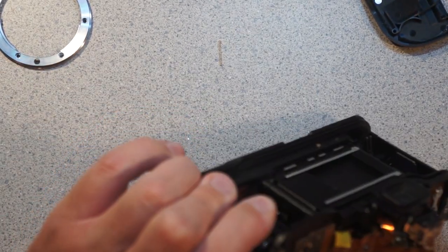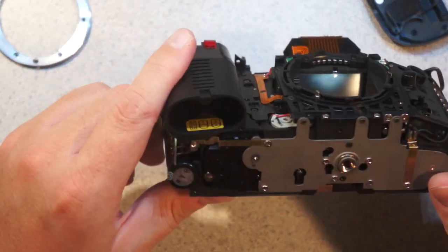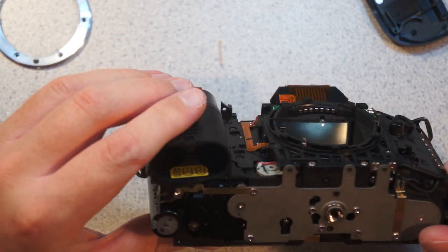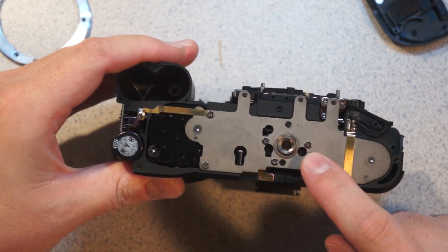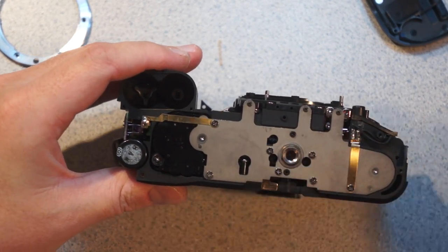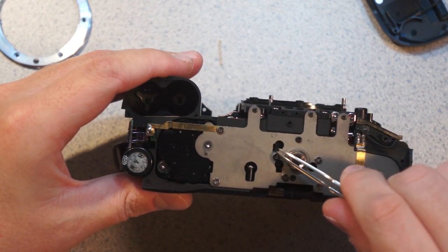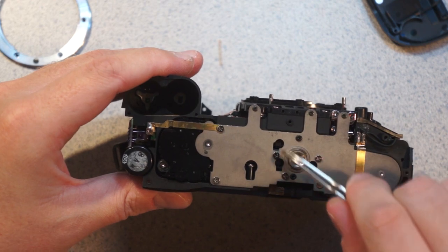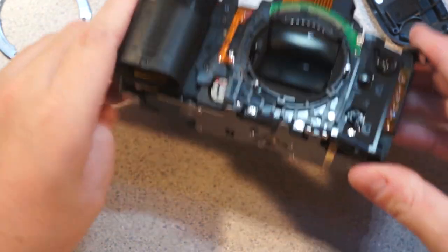I guess it would still work, though. You could definitely determine which direction it's going with only three potential states. Anyways, there's something interesting, which I should probably point out. If you look down in here, you see those slotted screws? There's one behind this belt here. As an aside, there's a belt! So those three screws, that one and these two screws, are how the autofocus is tuned.